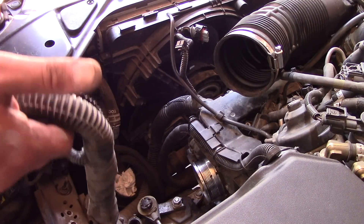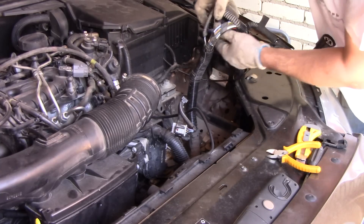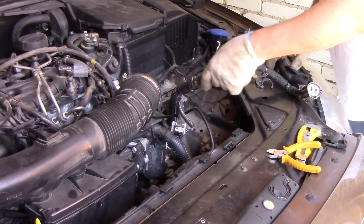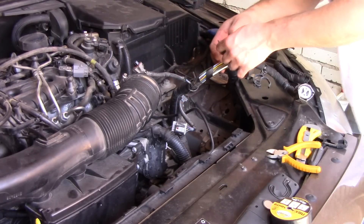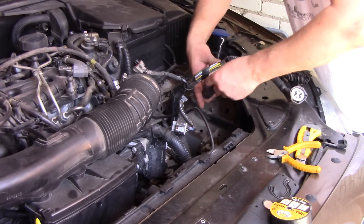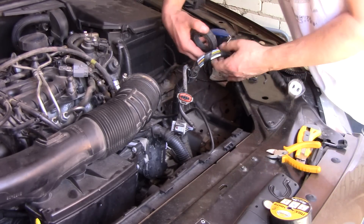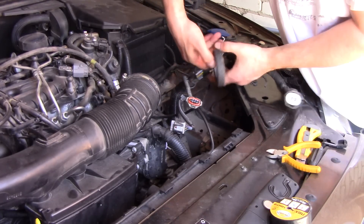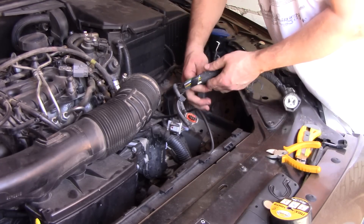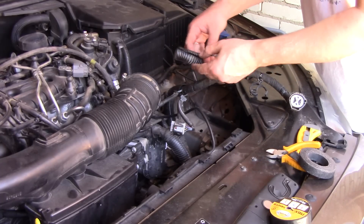The wiring loom is now off the wires. Take the special fabric tape and tape the bare wires as tight as possible to make sure they're nice and snug. This will protect the wires from rubbing inside the wiring loom due to vibrations — this is what others have experienced with their Volvo, causing glitches.